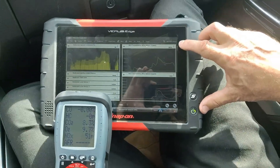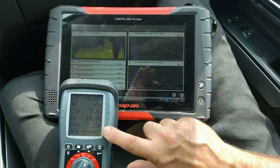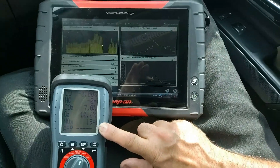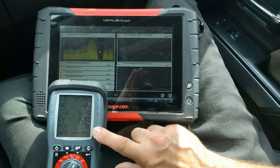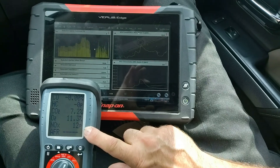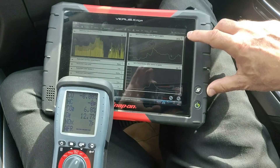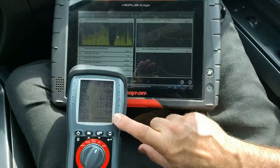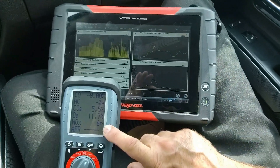Pretty good numbers — 250 in the front, 9 to 11 out the back, now down to 5 in the back. Our gas bench is green and diving too, under 20 parts per million. It looks like it's going to level off around 15 to 18. This truck is fixed with a pair of new NOx sensors. Final steady cruise number: 330 out the front, 5 out the tailpipe. NOx agrees on the gas bench at 6 parts per million. This truck is fixed.